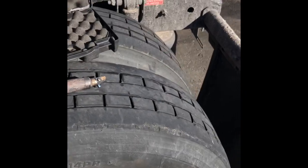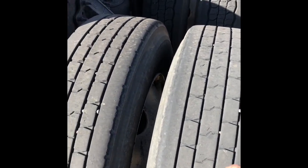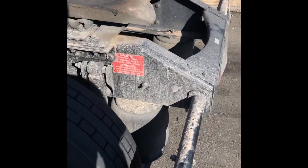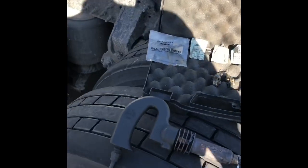Let's put this in perspective. These two tires right here — I just bought these a couple weeks ago, gave $200 a piece for them at one of the major brand truck stops, somewhere between 30 and 50 percent tread — probably closer to 50 percent — plus the mounting and balancing and disposal of the old tires. Now look — the tread on these is almost as deep as on those over there. It took me about an hour to do this re-groove.